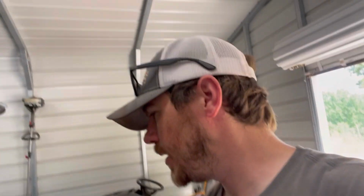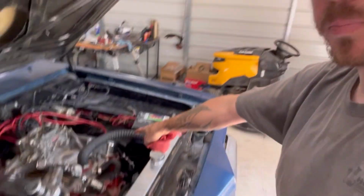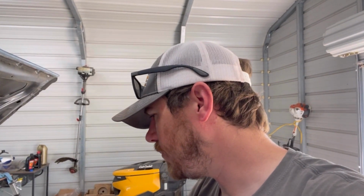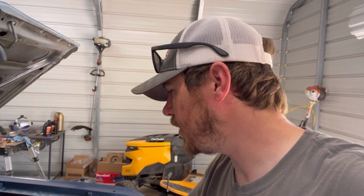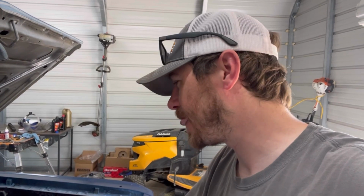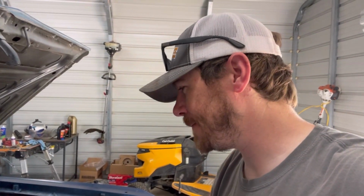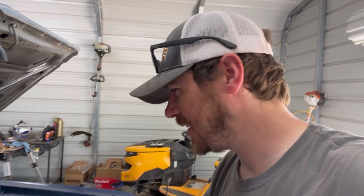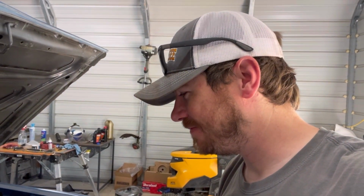I don't know if maybe when I noticed I had a couple leaks, I had missed a plug on the intake. Very possible that coolant got down that way. So now I have to drain the oil, get another oil filter, put more oil in it, and hope that that goes away. And I need to retighten the header bolts, so looks like another trip to the parts store.